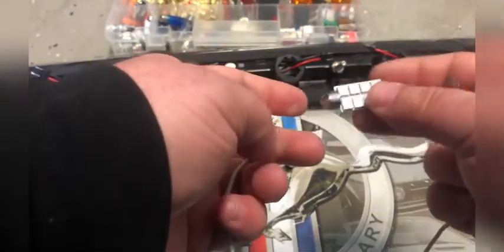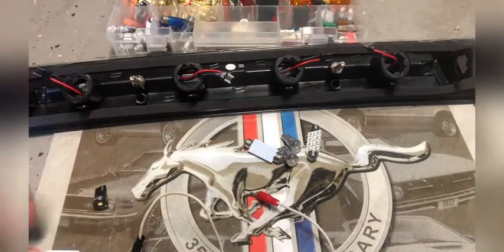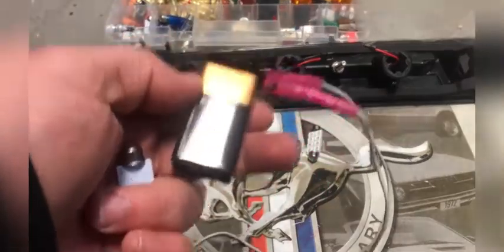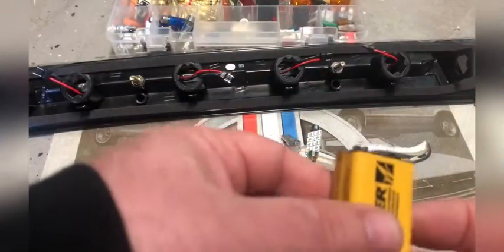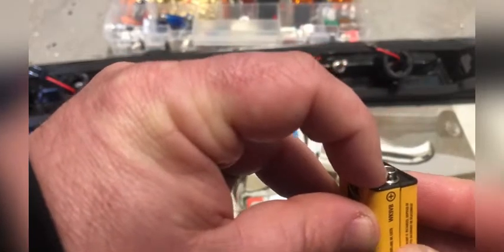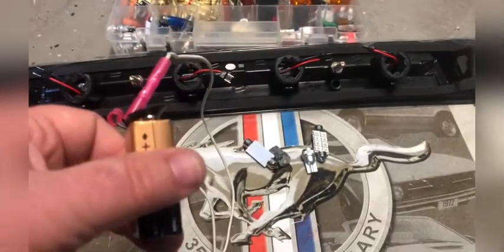And yes, you'll turn it on and you'll flip it and it'll work fine, but you've decreased the life of the LED significantly. And something else, whenever you're making your own polarity checker with a 9-volt battery, please look at the battery. Everybody gets it confused, but the large side is the negative and the small side is the positive. So if you flip this and get the polarity wrong from your tester, then you've defeated the entire purpose of trying to find the polarity of the LED.